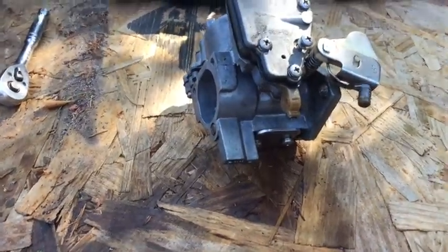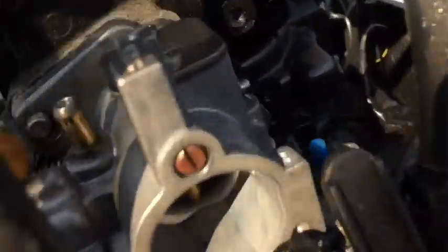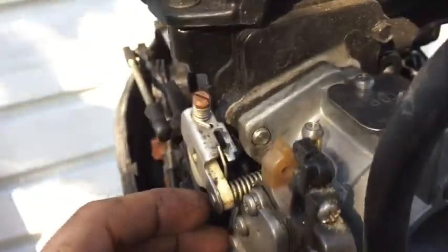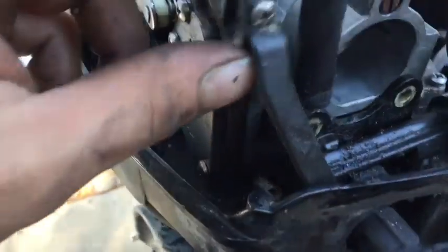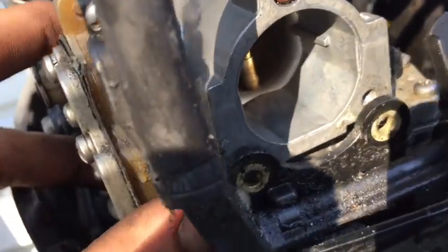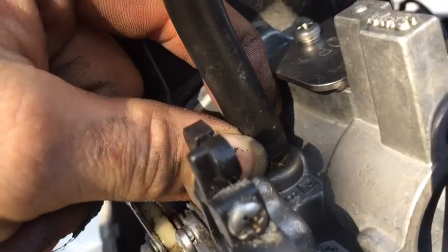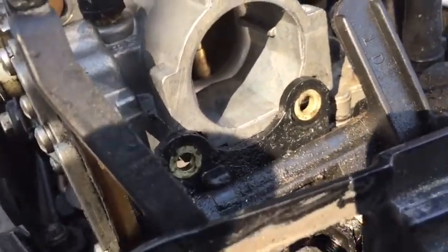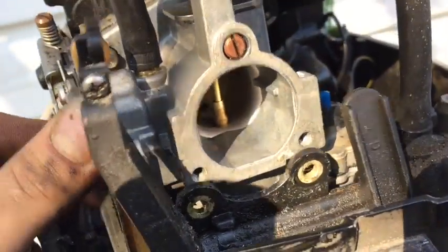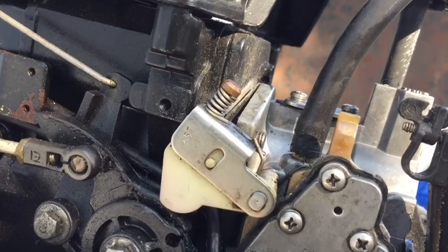I got the carb wiggled back in there. What's best is to get the bottom stud on there first, then slowly wiggle the carburetor down, watching this plate. Once it's wiggled down you can put your two nuts back on. Actually, it might be better first to put the air cleaner piece back on — while the carb is still a little loose you can tilt it up to get to the nuts easier. Hook the fuel line back up and put a zip tie on there.